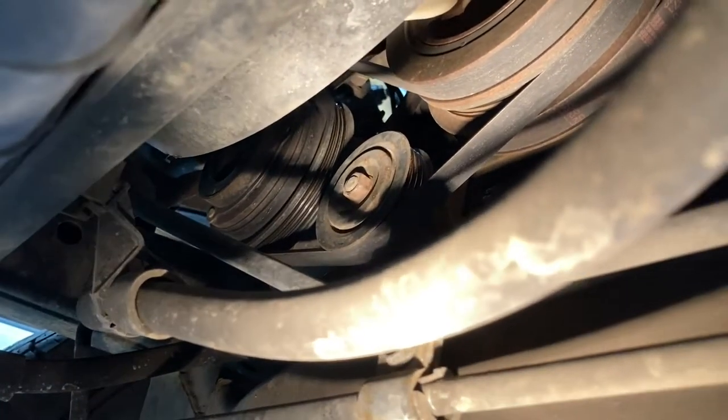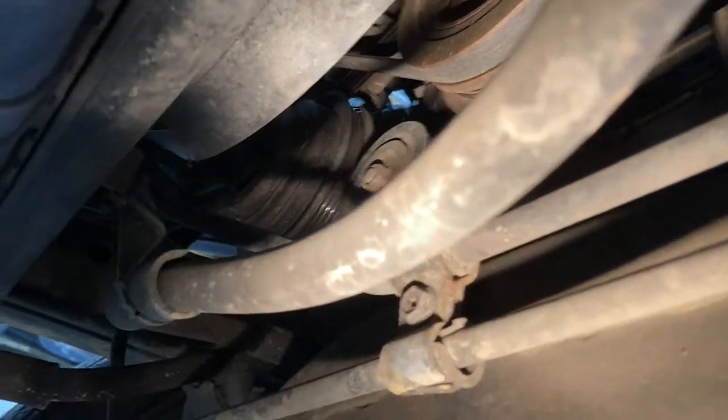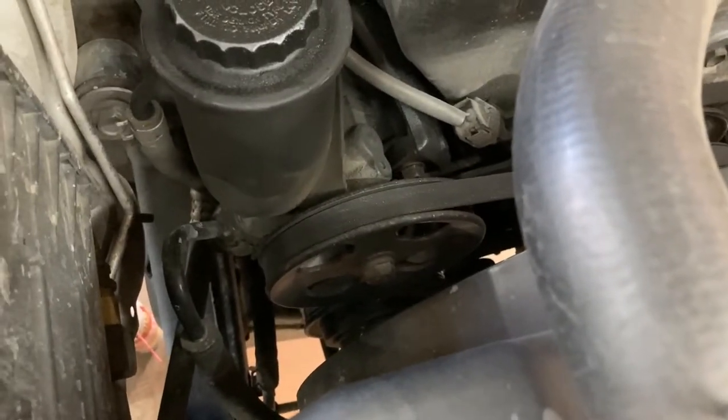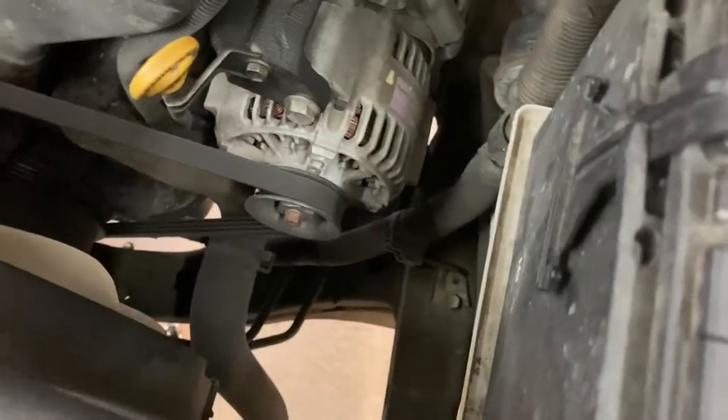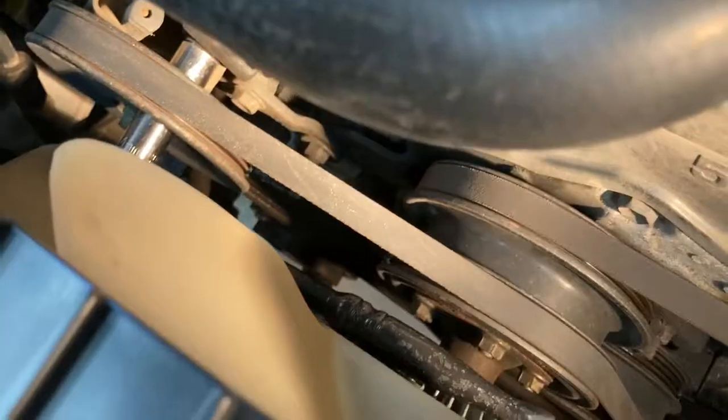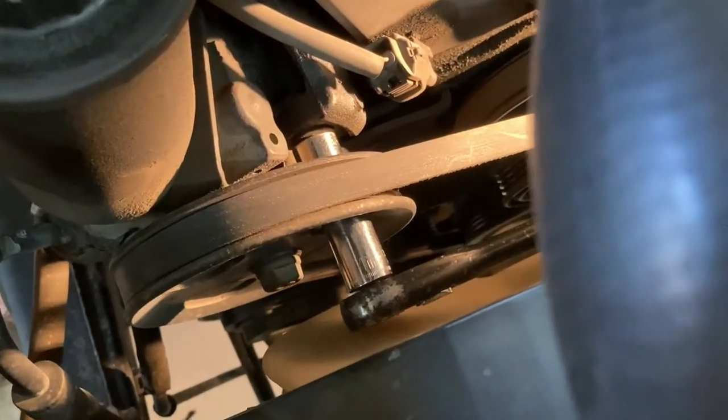Okay, now with the skid plate off, you can see it gives us quite a bit more room to work with to access some of the hardware we're going to need to remove to get these belts off. So first up, I'm going to start with the power steering belt that's located here on the left. And then I'm going to move on to the alternator belt, and then I'll remove the AC belt, which is located down below. Okay, so the first bolt we're going to need to loosen is this top bolt right here,